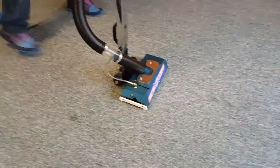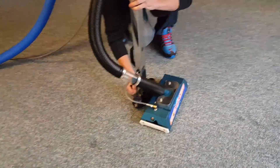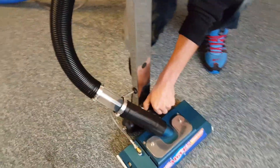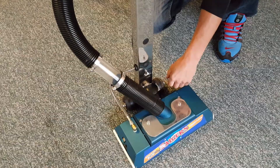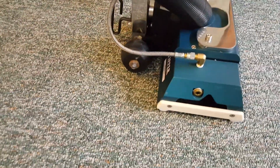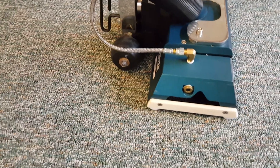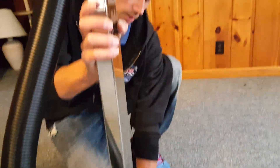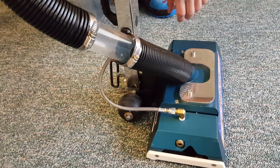That's for if you've got thicker carpeting, thicker carpeting and thick pad, and it wheelies — take and adjust that screw in that direction to fix it. Go clockwise so that the wheels go down, and that raises the rear. If you're doing wheelies, it means your wheels are too high in the back.